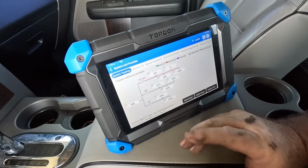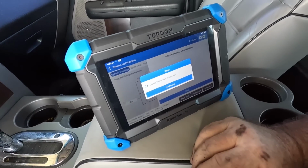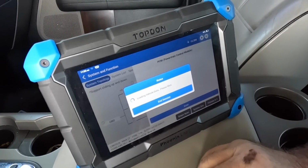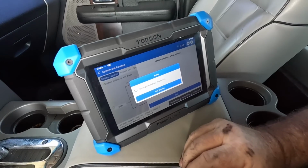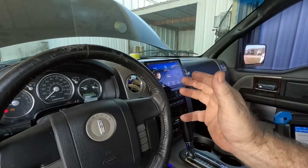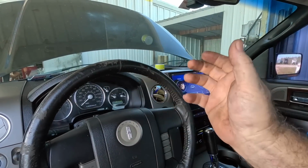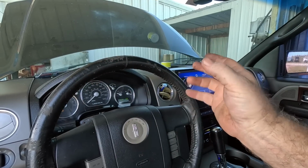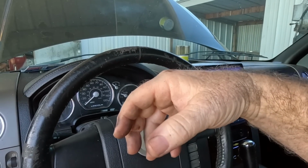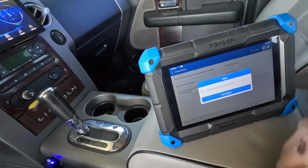Well, nowadays actually that's not accurate. I should say just needing spark plugs. Because a tune-up's not what it used to be. It's basically spark plug labor, check the air filter and the PCV valve, replace those if they're questionable. Back in the day, a tune-up was you adjusted points, you adjusted all kinds of carburetor settings, because as things wore, those tolerances would change. But today with modern vehicles, the software adapts as the mileage comes on. The software compensates for it. So tune-ups are... Anyway, special functions, power balance.